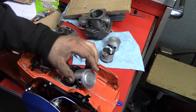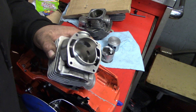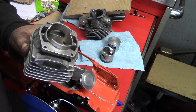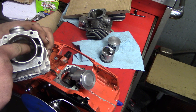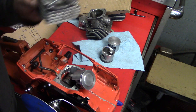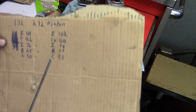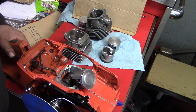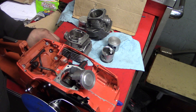If you're going to try to mimic this build, just be careful. I wouldn't recommend trying to raise your upper transfer unless you have to because for me this is a Nikasil cylinder — higher chance of scrapping it. But I could sand down through the plating, put some bevels on this and then slowly raise it. I thought about doing that, but I'll run it here and we'll see how it performs. Hope all that stuff makes sense for you guys. Till next time, keep on feeling the heat guys.